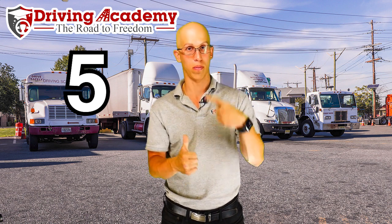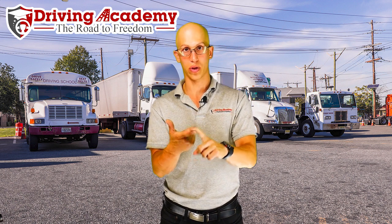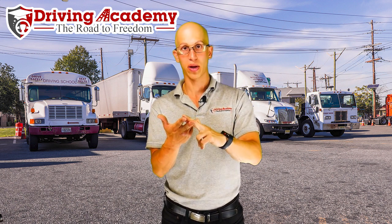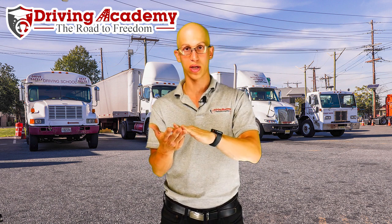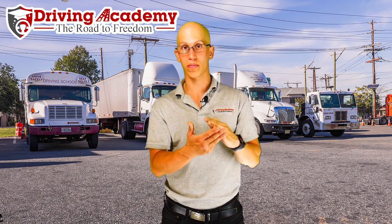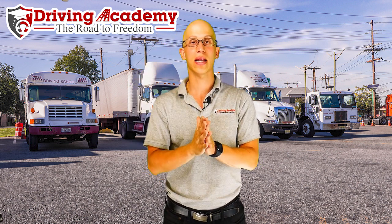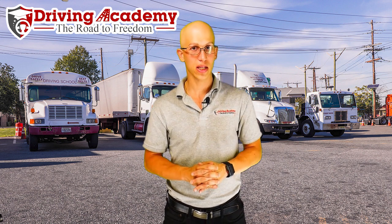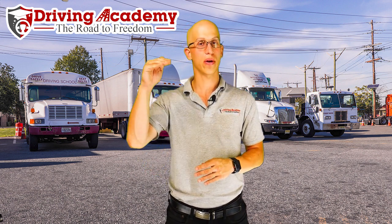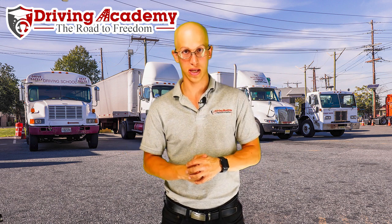For instance: I have my brake chamber — and you describe it. I'm going to have my slack adjuster and push rod — and you describe it. I'm going to have my brake hoses, lines, and couplings — and then you say what you've got to say. I'm going to have my brake drum, and finally my brake lining. If you run through that checklist on the brakes, you're going to get easy points throughout the whole system. When it comes to passing the pre-trip inspection, you have to get a certain amount of points correct in order to move on to the next step.